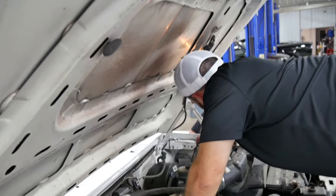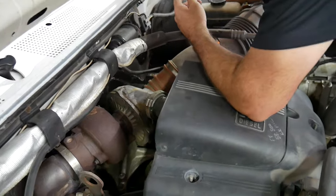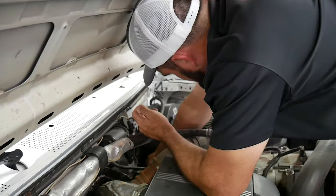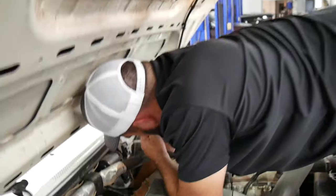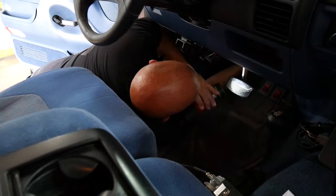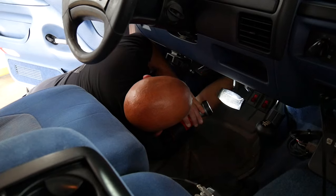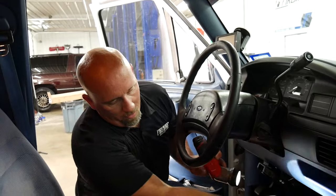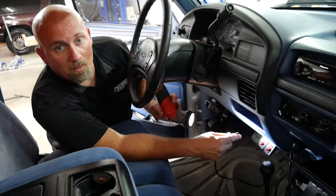I'm ready to feed it through when you are. I'm going to go under the master cylinder with it so the wire is not flipped up in the way. I should be through the hole, Brian. So he's running the wire through — let's go inside and see if we can find it. It's right here by the steering shaft. Just make sure you pull it all the way through and secure it out of the way of the steering shaft so it never gets in the way. Now we can run it right up here to one of the switches and plug it in, then go back under the hood and connect the battery.